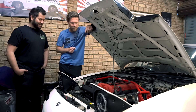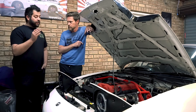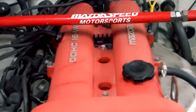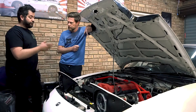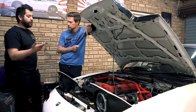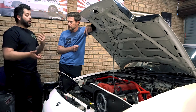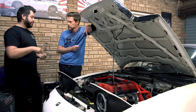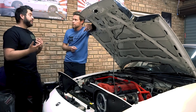We will get there, so that's coming. So what do we need to do to check the compression? First up, remove the spark plugs, fit the compression tester into the spark plug hole, then disconnect the fuel pump by the fuse or whatever, full open throttle, crank at four to five revolutions. Then start checking what PSI or bar each cylinder is. If there's one that seems lower than the rest, take about 10 mils of oil, put it in there, and rerun the compression test. If the compression is higher, that means your rings are shot. If the compression isn't higher, then you know it's something in the head.